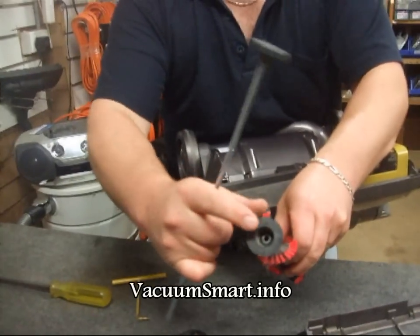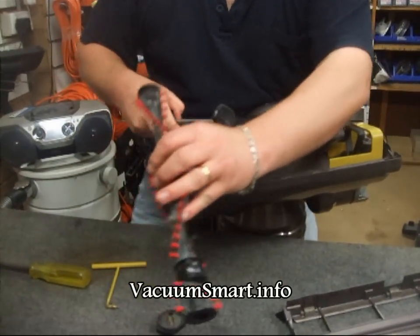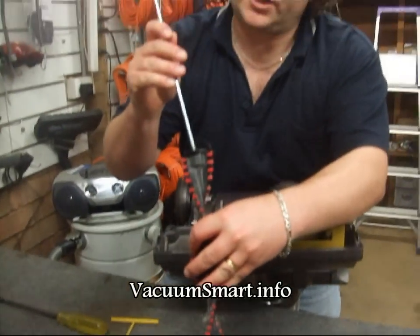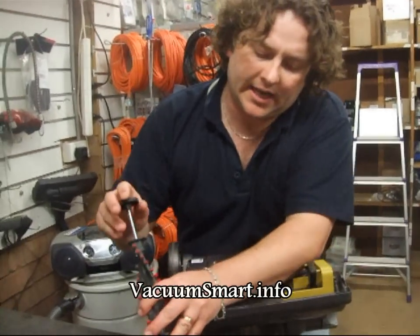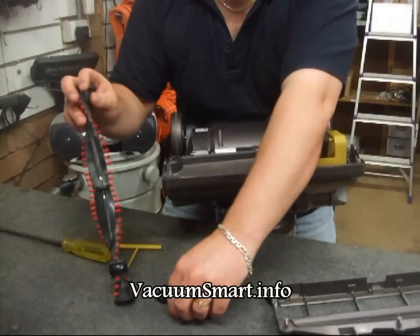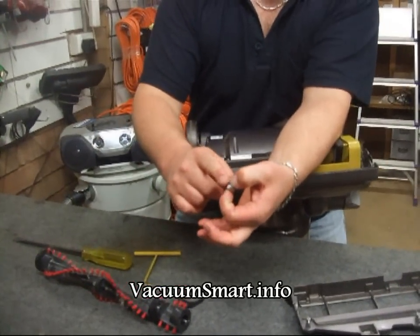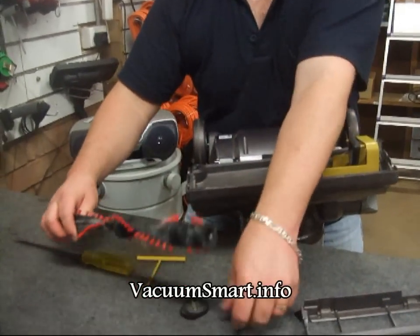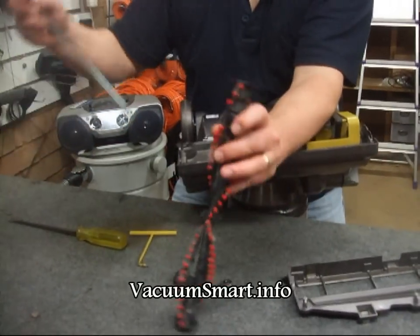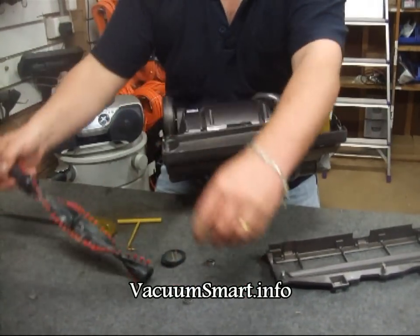And you can have a look for any material in the end here. Your best bet is to actually pop this driveshaft back in and tap until the bearing itself actually comes out. Just check that it rolls nice and smoothly. There's one on the other end as well — take that out, and there it is.